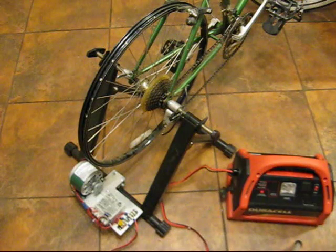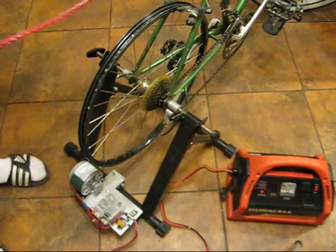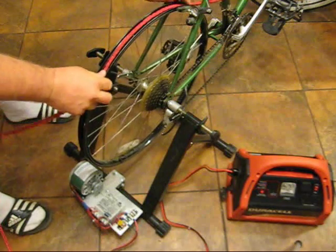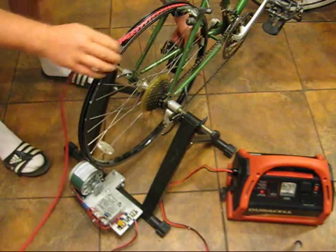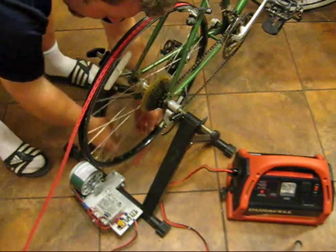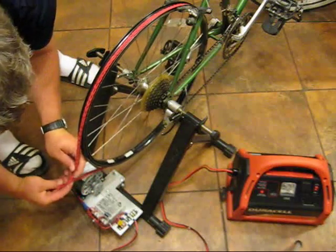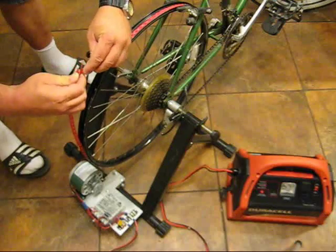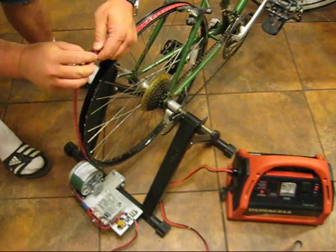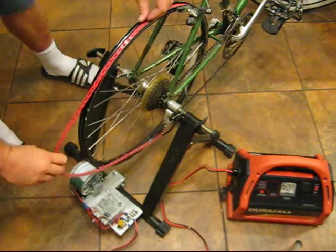Let's try putting this belt on, making sure the tabs are pointing in the opposite direction of rotation. Here's the rotation direction, and the tabs are facing that way. Loop it around — the belt will have a tendency to want to flip over, but that'll go away once you do your final few steps. Now bring it around, put the belt together, turn the tab sideways, put it through, and wiggle it. Now it's together, and you're going to roll it onto the generator.